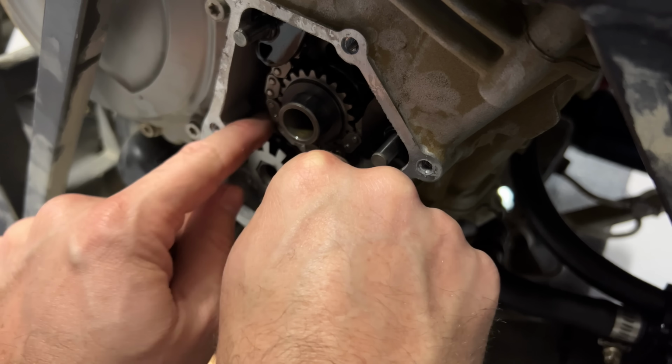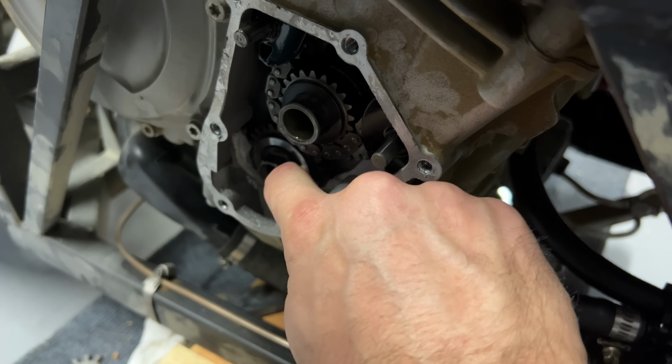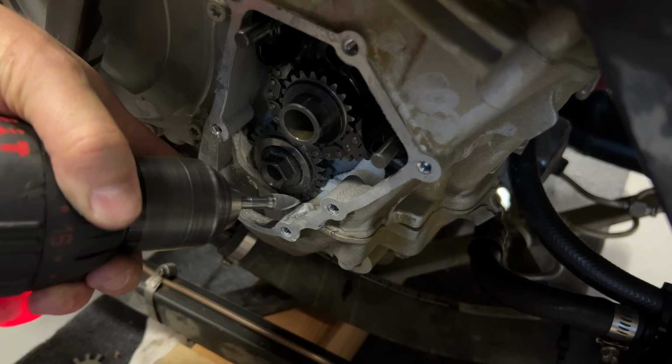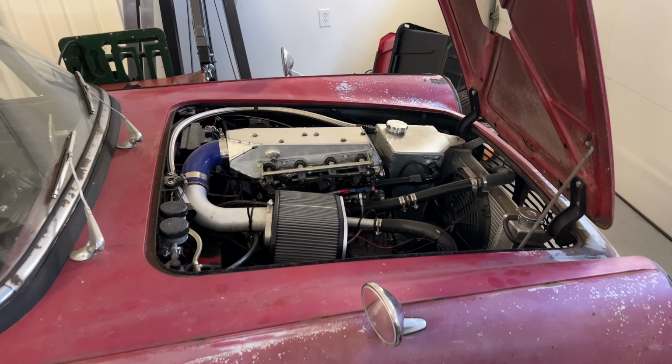To get the right width and the right spacing for the teeth, I could only get 12 teeth in there. 11, actually. There are spaces for 12, but 1 is missing. I even had to go in and cut away some of the aluminum for clearance, adding even more metal shavings into my oil pan. The engine originally had 58 teeth, or 60 with 2 missing. I'm assuming 11 is enough because that's what Honda is using on the engine in this thing.